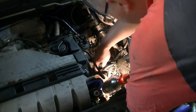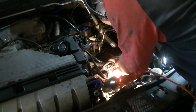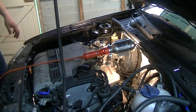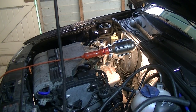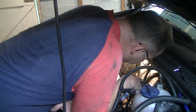Working around the transmission, we can also disconnect all the transmission harness plugs. That's probably all I'm going to do for this first session — pretty good progress so far. Most things are clear of the engine: fuel lines are off, coolant hoses are off, electrical connectors are all off. Next step according to the checklist is to take the exhaust off, so I'll be coming back tomorrow to do that. I'm just going to spray it down — I only have WD-40 but better than nothing — give these bolts a bit of spray to make life a bit easier tomorrow.